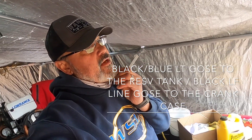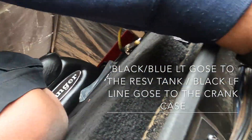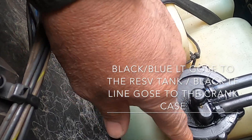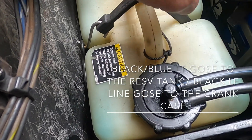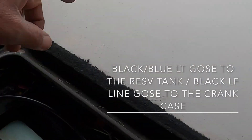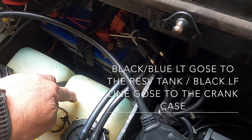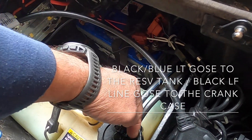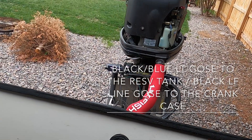I don't want to sound redundant, but I just want to explain how this system works. This tank has to have pressure in it and you don't want anything leaking — everything has to be sealed. What happens is when you start your engine, from your crankcase that line goes all the way into your oil box right here. The pressure is pumping air in here, pushing down on your oil. It goes through your pickup, through the bottom screen pickup, comes out of here, and goes into your box. That's how the system works.